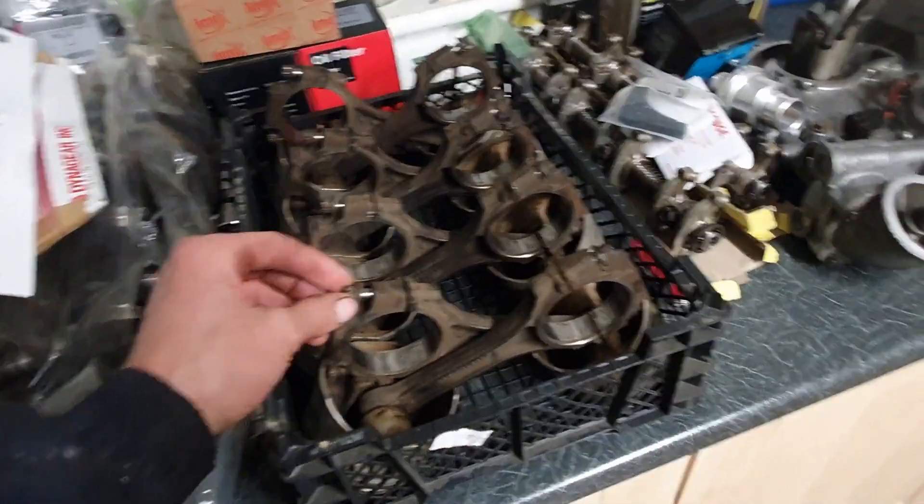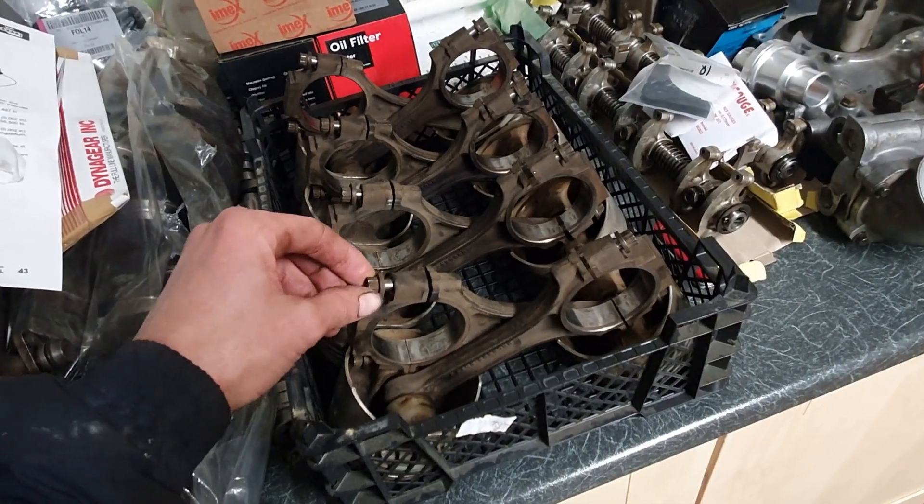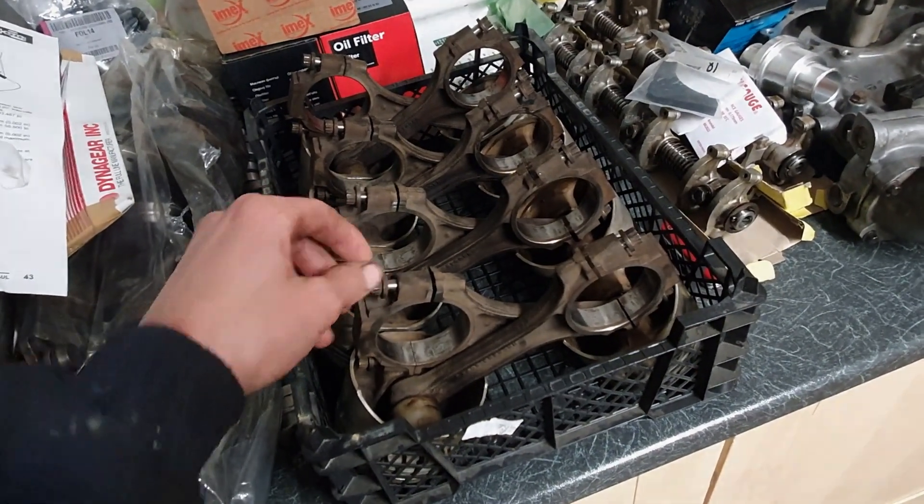They have new stretch bolts, but I think I'm going to reuse the old ones in a couple of places just for doing plastigauge testing, and then I'll put all the new stretch bolts in for the final assembly. That's all for this video folks. Join us again for the next video where I will get the engine block and the cylinder heads back from the machine shop, check them over, do some final preparations, and then do all the dry assembly and clearance checking of the bottom end. We are building towards the final assembly in a subsequent video after that. Thanks for joining us — I really hope you're enjoying these videos. Tune in again.